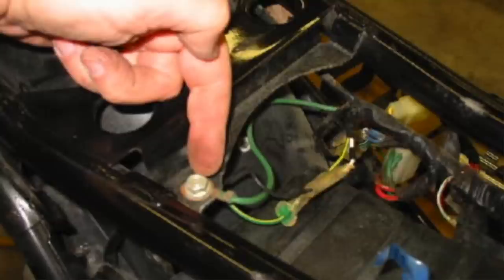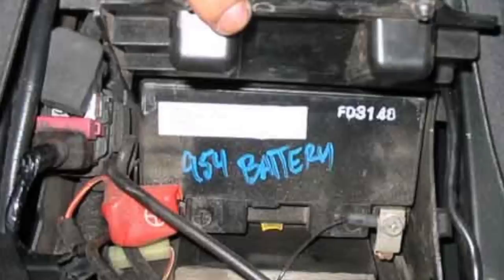You have four wires. Your black wire is your ground — we recommend going to the frame, or if not, run it straight back to the battery. Tachometers are by nature very ground-sensitive, so the better the ground, the more solid the reading and the fewer issues you'll have with the tach needle fluctuating.